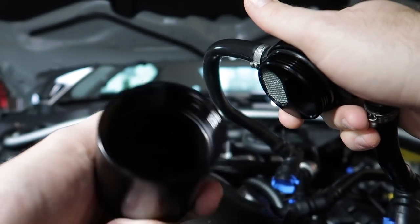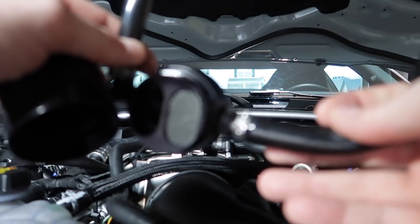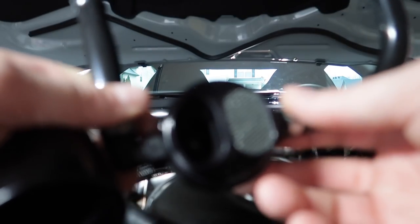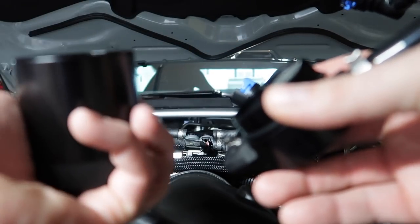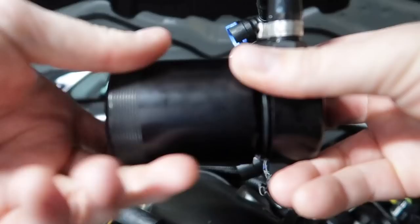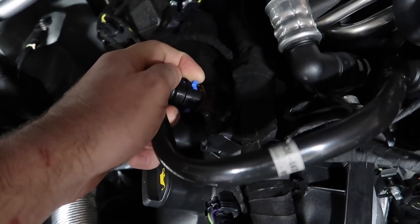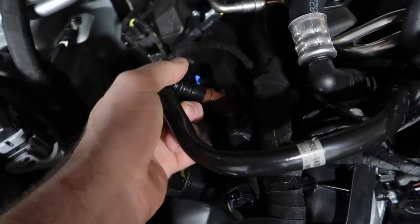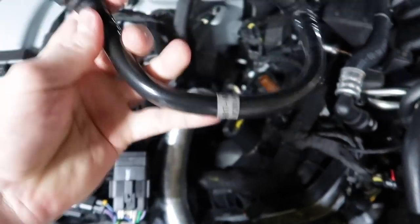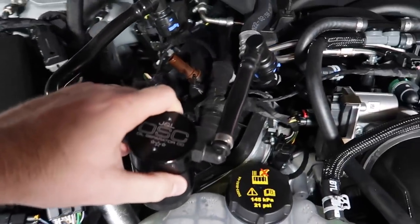There's a rubber O-ring seal so you won't have any leaks. The internals feature a little mesh screen — crankcase pressures and air pass through here. It works like a check valve, only goes one way, and it's going to collect any debris and catch it in here. About every oil change or so you can empty these out. You have this little blue tab — push it forward and then down and it should slide right off. Same thing on the other side and it pops free.